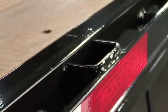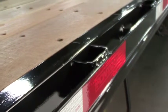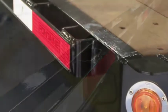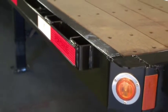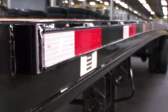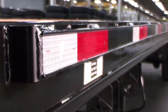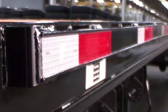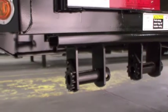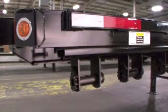The trailers are standard with both stake pockets and pipe spools located on 24-inch centers on the sides, which are also approved load securement anchor points. These feature full continuous welds for optimal strength and safety. The outer steel rub rails are two and a half inches wide and are recessed in the center with raised outer edges to accept and provide protection for the DOT-required conspicuity tape. For load securement, the Velocity comes standard with 12 sliding winches and full-length steel C-channel winch track on the driver's side.